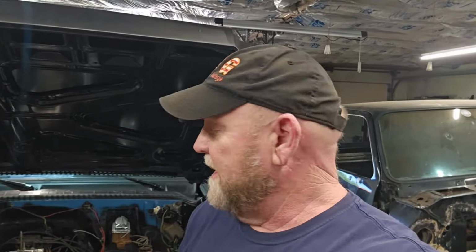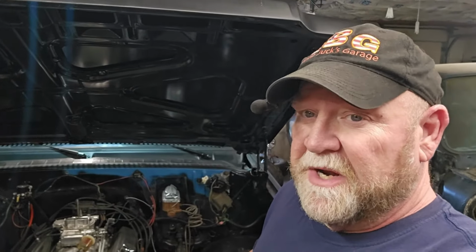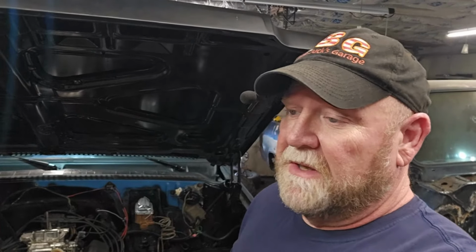Okay, so the first thing is that the battery's fine. Turns over, you know, no broken motor parts, nothing like that. The carburetor is leaking a little bit, so it needs to be tightened. It needs to be addressed a little bit because it had a couple drips on it, but it's just not hitting. It just stopped, key on, and dead. Then it turns over, and the battery is fine, so what does it got to be? It's got to be fire.